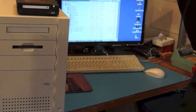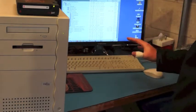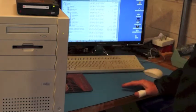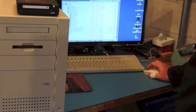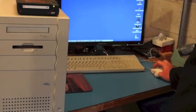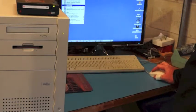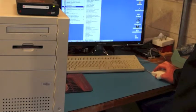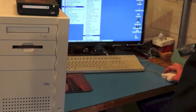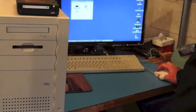The issue there is that you may not want to open it up, take out the drive, reformat the drive, which you could do in a system like this. This has enough I/O channels where you can just plug in a drive. And what I have here is OS 9, but this system is excellent, because if we go here to startup disk, this thing will also boot in System 7, which a lot of these systems can't.